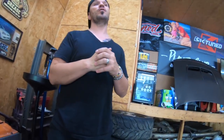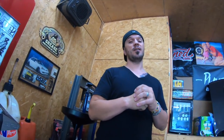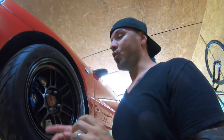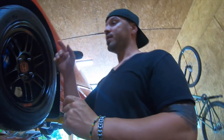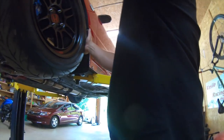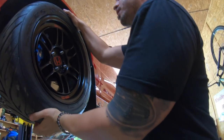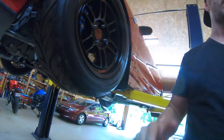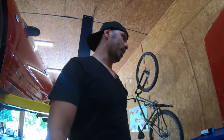Since y'all joined in this video, today we're going to fix something on Monica. I'm going to show you, we have a wheel bearing problem right here. Watch. Everybody quiet. Can you hear? Side to side, not as bad. Up and down, pretty bad, right? So that being said, we're going to replace the wheel bearing.